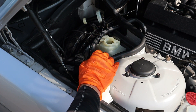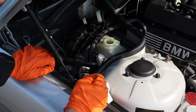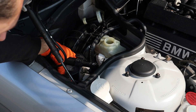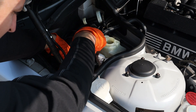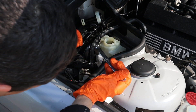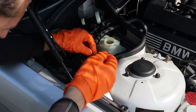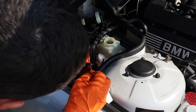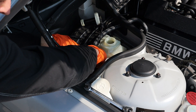I've emptied the brake fluid tank off camera. The pre-charge pump has two pins that sit underneath — these just literally pull up. All I'm left to do is disconnect these brake lines. Just to let you know, this is an 11 millimeter nut, not 10 as I said previously. Loosen these gently — I've loosened the thinner one and that's the thicker one of the two. Place a rag underneath to catch any brake fluid spillages, and just loosen the nuts.